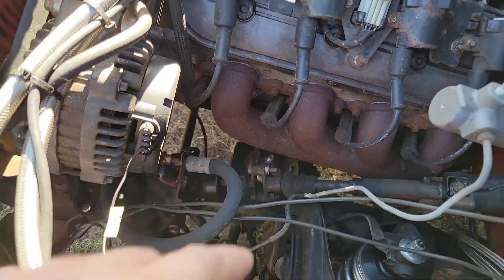I want to gusset my motor mount plates for the motor. Aluminum 5.3 - I'm putting in all Brian Tooley Racing rotating assembly, a Stage 3 turbo cam, and shaft rollers or rocker shafts, which basically turns your trunnions into a solid shaft for less valve deflection.